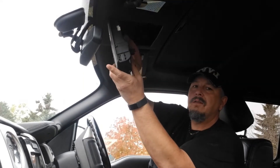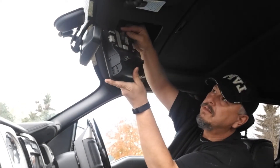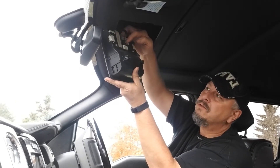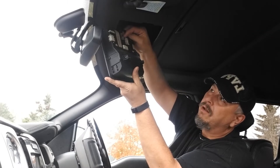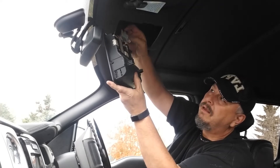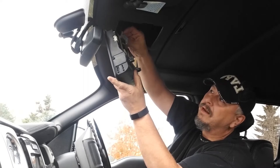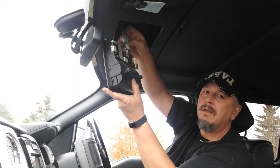You're going to see two clips — two connectors that have clips on them. One is for the actual relay that has the three buttons in it. There's a little button on the back; give it a little push and a little wiggle and it'll pull right out. That's the plug for your relay. The other plug is for the lights, and it has the same sort of clip on the back — give it a little push, a little wiggle, and you pull it out.